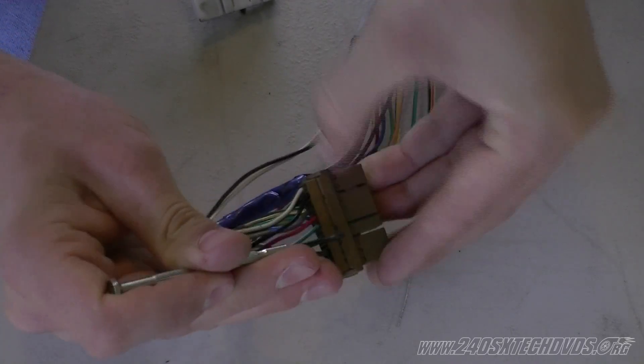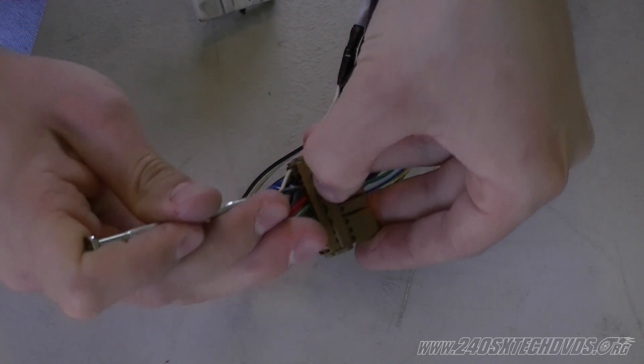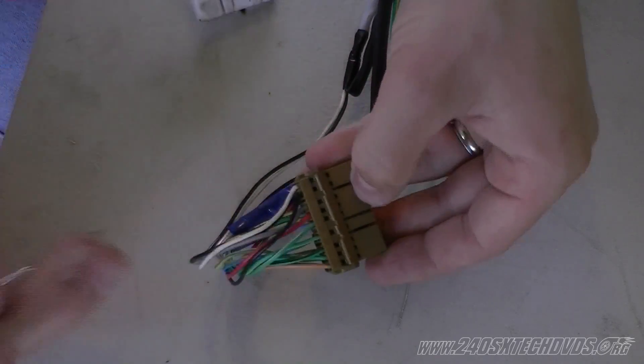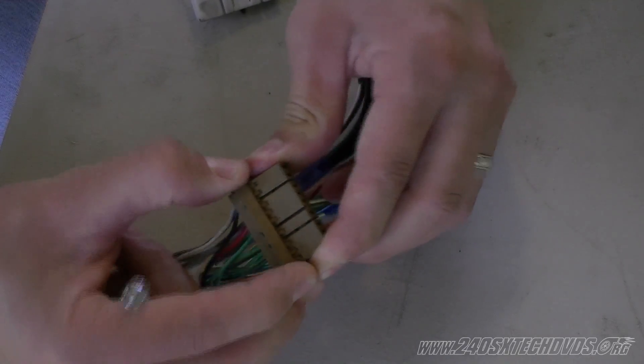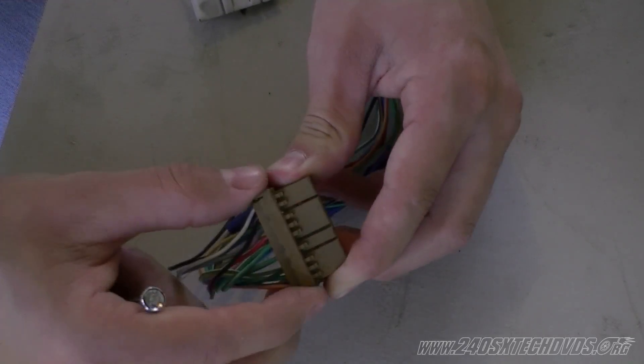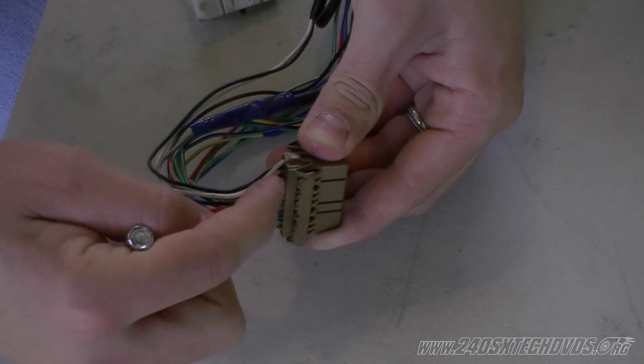That disconnects this side of the wires, then you'll flip it over to do the other side. It's almost the same design — just pull down with your fingernail and take a small flat head screwdriver and pop it out on this side, again being very gentle because you can break it. It has little spots where you can get underneath it, and there are some spots with teeth so you don't want to break any teeth or it will not latch back. You'll have to get a new connector.